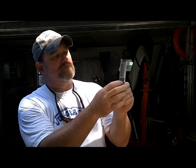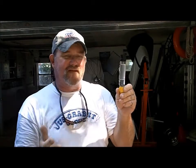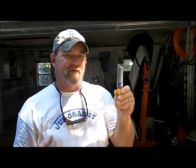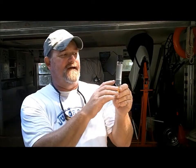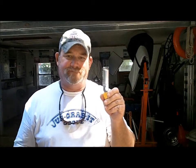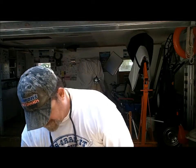Then what you do is look at the marks after this has been sitting for a good long while — 15 minutes is good. I let mine actually sit overnight, and with treated fuel from my Raycor fuel filter, I saw that after I put StarTron in it, I was actually running 5% ethanol straight into my Honda right here. I'm not sure if the StarTron had anything to do with it. That's the reason I'm now going to be testing the fuel straight out of the pump from the same gas station. So I'm going to let this sit for a couple of minutes, clamp it up here, and then I'll be back with the results.